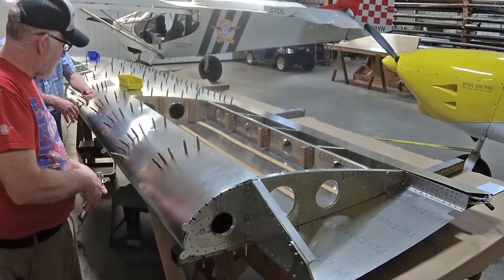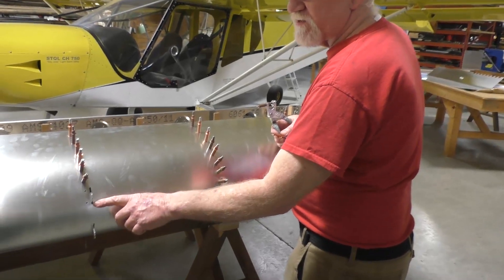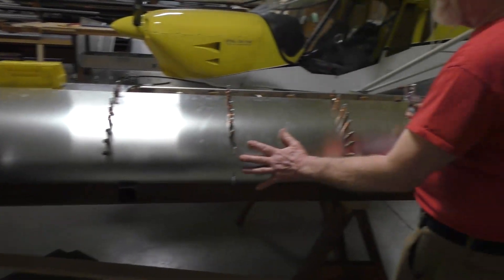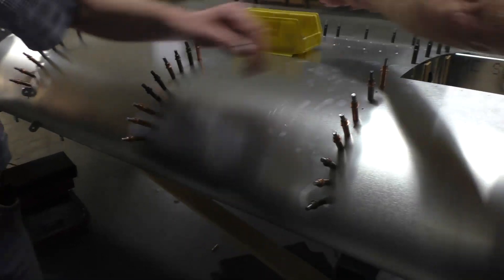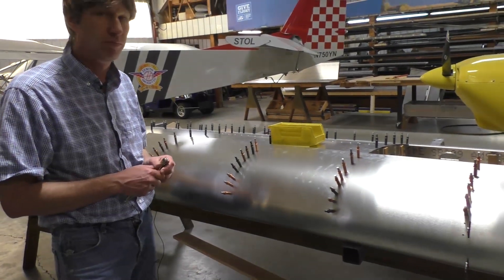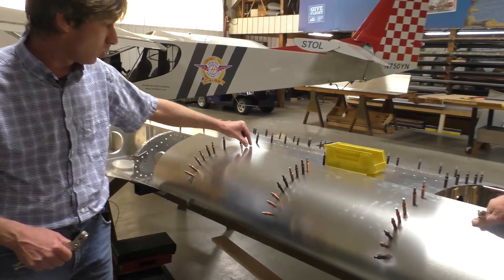So why are you going to put in a CLECO every single hole here? It's to help form the midsection of the nose skin because the end of the rib has a void in it. You want to make sure you push all that material down evenly so you don't get a lot of ripples. Sometimes you want to massage the CLECO a little bit because it'll start centering that hole a lot better. Since it's final hole size match drilled, it's an exact fit. So by using a lot of CLECOs we're really maximizing on that exact fit. The only thing we have to do now is CLECO the outboard section and then we'll have to drill the spar cap — that's the only thing we're going to have to drill.